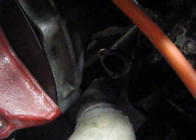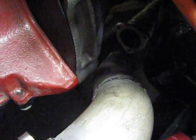There's a muffler at the back, but I think I'm going to at least delete my cat and have the 3 inch exhaust go at least to the front of the resonator. I just think you're going to get more flow that way.